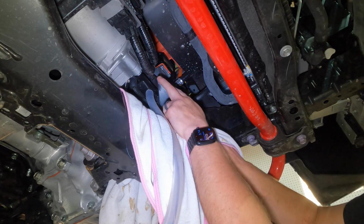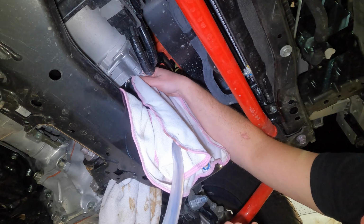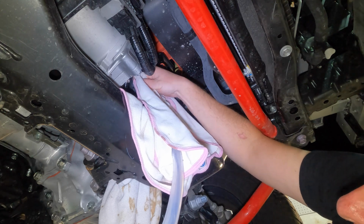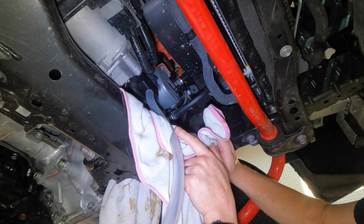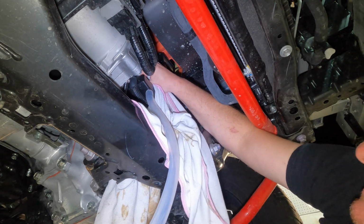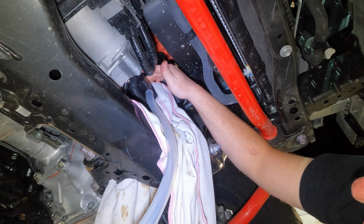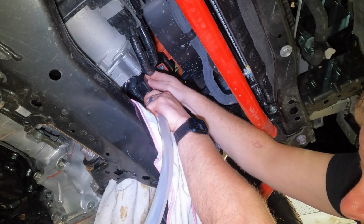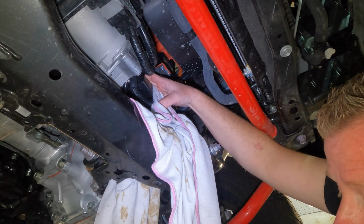So now all I'm going to do is, as the last little bit drains out of the black pan up here down through the hose, you can get your hand up in here. It's just a small little pan. It's not big. So I'm just going to get my towel inside there and clean up all the last little bit of oil from inside. That way when we disconnect this, there won't be anything dripping down out of it. I'm also going to wipe down the area that we removed the filter from, just to get it nice and clean. You can't really see up there all that well, but it's not a big area. So just get your towel up there, wipe everything down, and then we can go ahead and disconnect our 15 millimeter hose. Set that aside for next time.